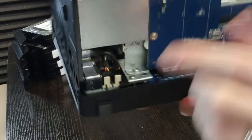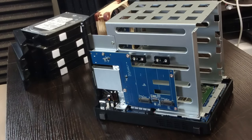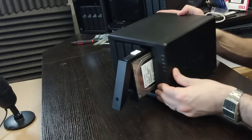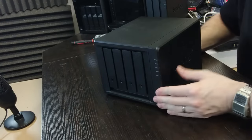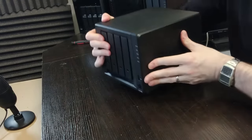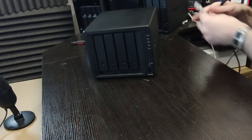After you've double-checked the power connections for each fan are attached and that the fans are secured with their four screws, go ahead and reattach the external casing, then attach both of the screws that originally held the casing in place. Carefully slide in each of the individual storage drives you removed earlier — they will go in a little more stiffly than before because of the new felt velcro panels, but they should still slide into all of the individual grooves they had previously.